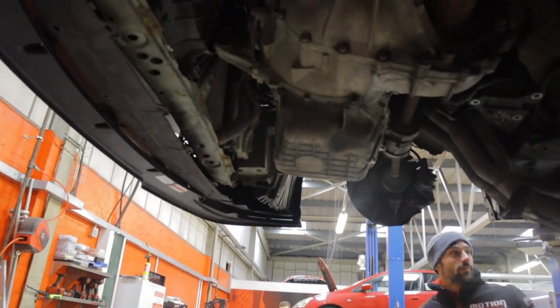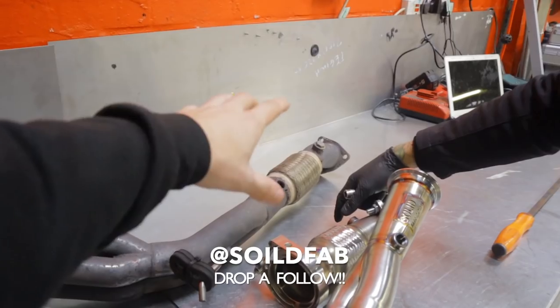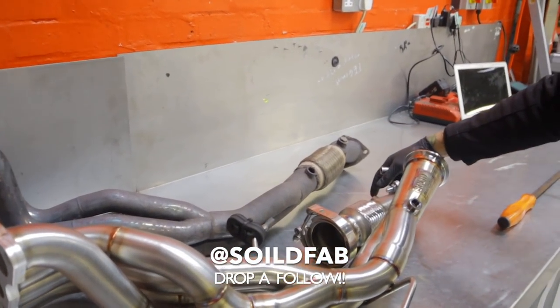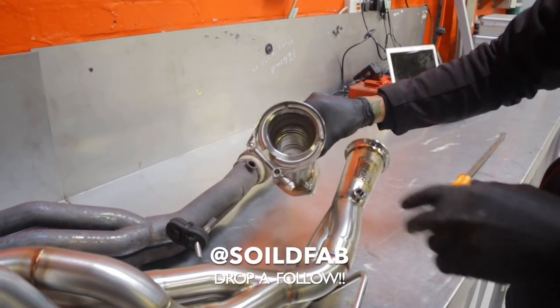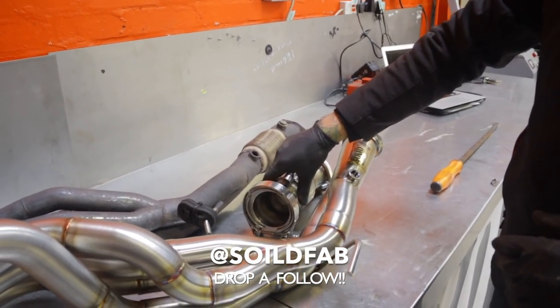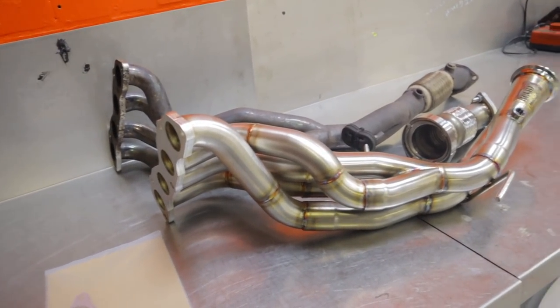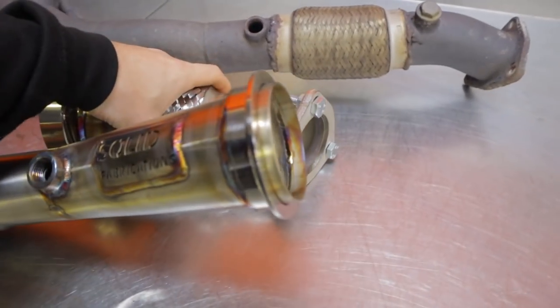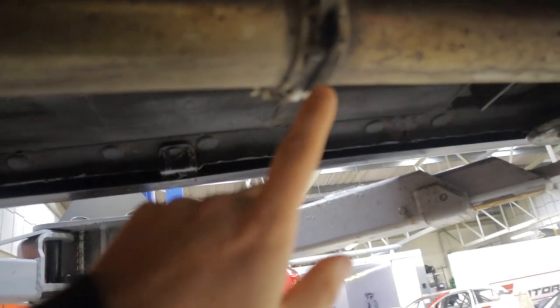I've never seen her like this. She's actually quite clean, isn't she? Not bad at all for her age. That's been hitting the bottom of the car - standard for a JapSpeed manifold, the flexes are terrible. So it's had a flexing point in it. Obviously this one is much better - it takes well. The V-band here gives you a bit more movement to put the Y-pipe up and down and stop it knocking on the centre of the car. It's bigger diameter as well. Dave's found a pretty deadly leak in the exhaust system - so all that time I've been moaning about the exhaust being too loud and too droney, that's probably why. Hopefully after this the exhaust sounds nice.